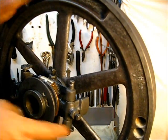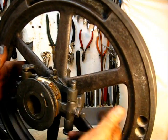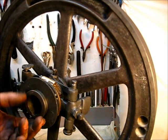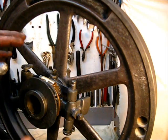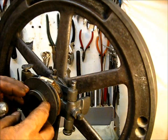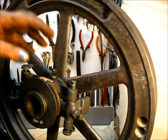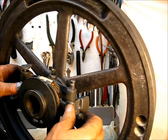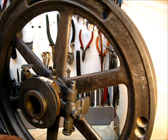I will oil this liberally. Do not put any anti-seize on there, and don't put any grease on there as of yet. Because the grease will come out and grease up this area in here, but all of this back in here is lubricated only with oil. If you put grease in there, what you're doing is building a dam and the oil cannot flow.